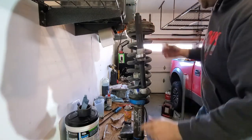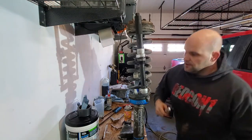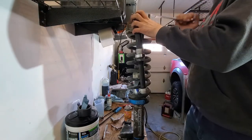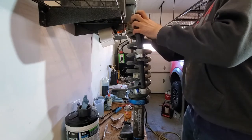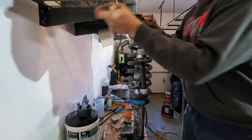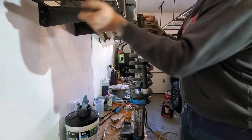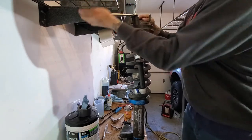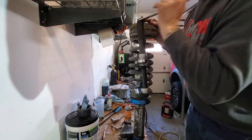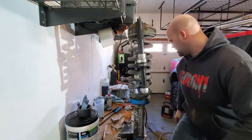We have to compress these down a little more now that we moved to mid perch, so the spring will be a little more preloaded, which will hopefully give it a couple inches of height. I'm not expecting it to be completely level, but close to it. I just go down until I'm not noticing any new threads showing up on the top of the cap.